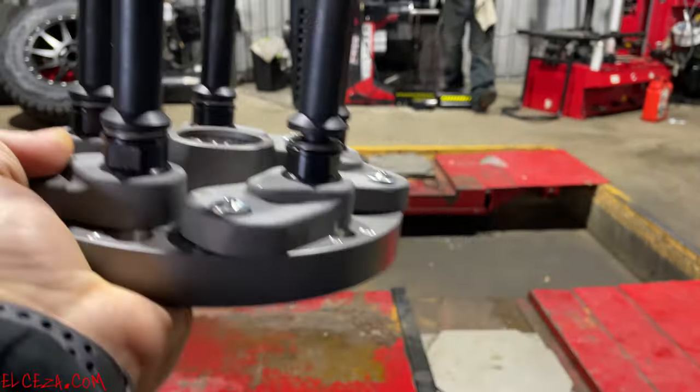Keep it clean. If weights get underneath there, I get it. But about once a week, you might be able to build them a hook. Just have a piece of slick rod with a bend in it where you can reach underneath and pull all that debris out from under the balancer. Because when I get a pile of debris underneath the balancer or in the sled of the wheel lift, it creates a fourth contact point to the ground, and it's not vibrating like it should. So it'll start chasing weights.